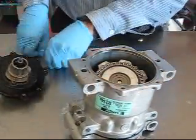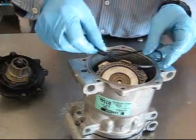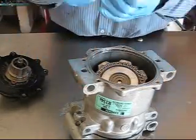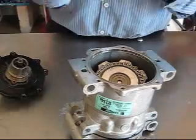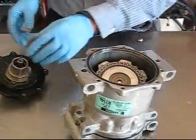Next is the O-ring. If it's an earlier one, it's going to be a square cut O-ring; if it's the newer style, it'll be round. It should sit right in that gap. If it doesn't, give it just a little bit of a stretch, because if it pops up out of there when you're bolting it together, it will cut and leak.